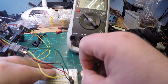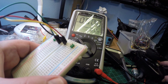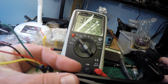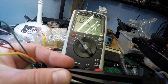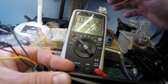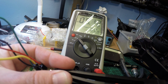And those, I guess they have an integrated light controller, because the voltage that is coming out of those pins is much higher than red LEDs would allow to be used. So here you can see it's 3.8 volt or 3.9 volt if I'm not braking, and if I'm going to brake, could you see it shortly? 5 volts. I'm braking more than 5, so it goes from 3.7 to 5.1, 5.2 volts. But a red LED is only made for 2 volts, so there has to be an internal light controller that regulates this, otherwise the red LED would not work.